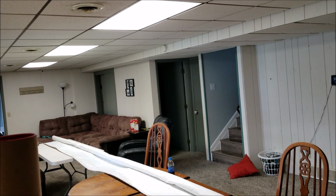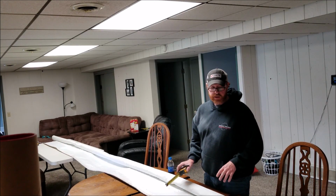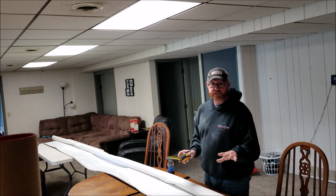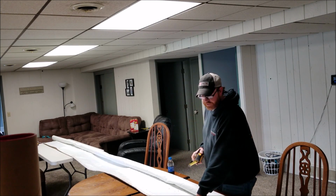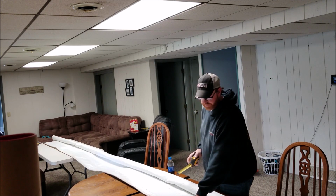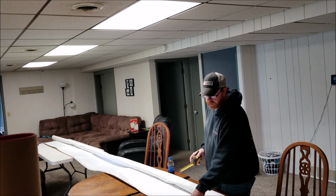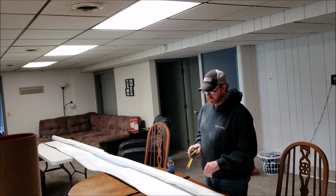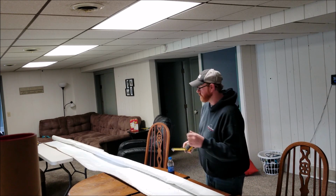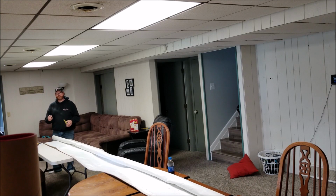All right, so I'm measuring them to get rid of the majority of the bad stuff that's weathered by the sun. 5 inches in is where I need to be, so I went another inch just to make sure I have good material the whole way down. So 6 inches is what I'm going in. And then this fold is 1 inch from the piece of plastic in the middle, 1 inch from the edge in. So I went 1.25 inches to leave gap for the actual plastic piece that slides in the channel. So 6 inches and 7.25 is where I'm going in. That's going to be the full length of it. I'm just marking on both ends so I can snap a line.